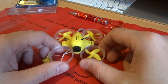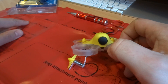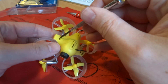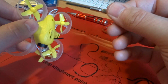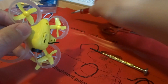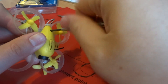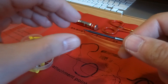Now I'm going to start disassembly of the original frame. I've put down a rubber mat — it's an old IBM field kit from my field tech days working on laptops. All screws here are super small jeweler size. The rear one is very deep so you need a very small screwdriver — an adjustable bit won't fit in the hole, so you really need an actual jeweler set. These are all just Phillips screws. If you can magnetize your tip, that helps immensely.